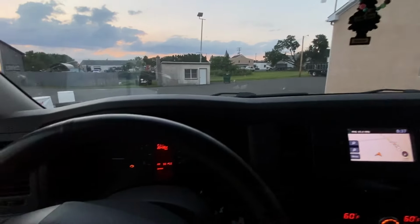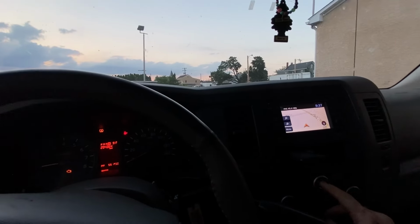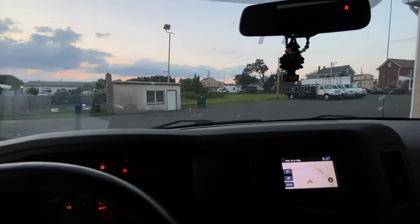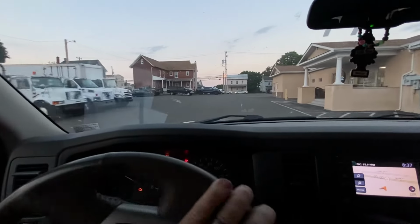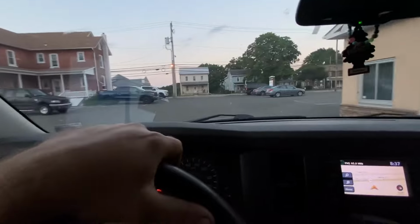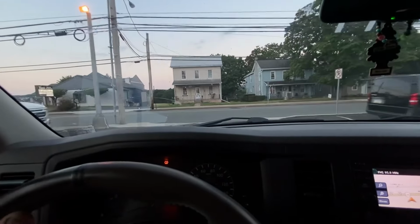Hopefully you got lucky. This thing has a lot of miles on it, 294,000. That's a heck of an event to go through, losing fluid, losing pressure with that many miles on it. But she has all fresh fluid in there, flushed. I did a low pressure flush, pulled off the cooler line and ran almost a whole gallon of fluid through it.